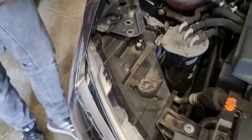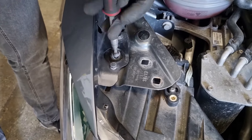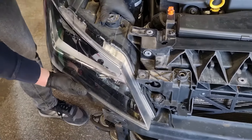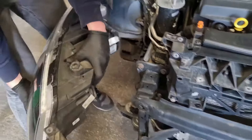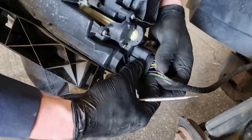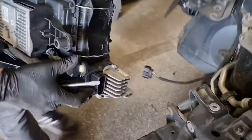And then the last one is this headlamp going to the inner wing here — that's a T30 again. Once you've undone that, you should be able to wiggle the headlamp with the bracket and the whole thing should come away. Then you need to get to the plug on the back — the tab just pushes in there. Sometimes these are a bit stiff if they've got a lot of grit in them from being in the wheel arch — just pop that out and that's the headlight removed.